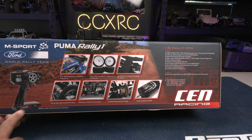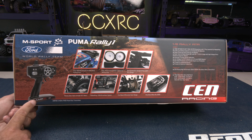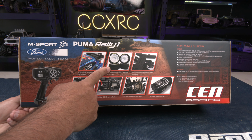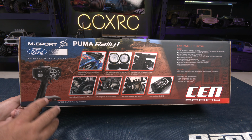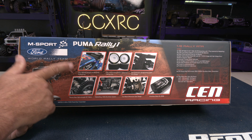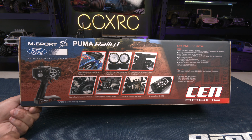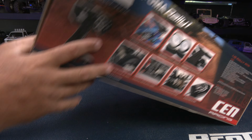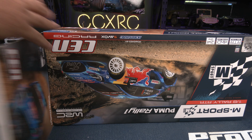And then here, it's kind of just showing those actual components. Hobbywing 100 amp ESC, mod 1 gears, running the basic radio we've seen with their other cars in the past, which has lots of features, and it's just a digital controller, digital buttons instead of having knobs and stuff. So we'll look at that. But yeah, it is a 3000 kV brushless system, full metal diffs. Let's get in here and show you guys this wicked cool car.